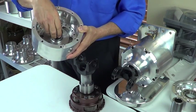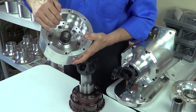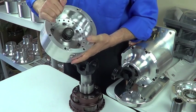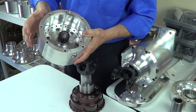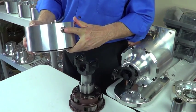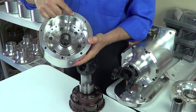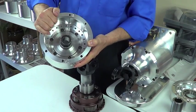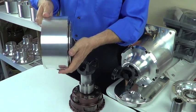The gear is 9310 material, rim polished, and then given a special treatment and coating for real endurance. In that carrier housing, we have a drain plug on the bottom. You also see alignment pins here to align the housings, keeping everything properly centered and properly engaged.